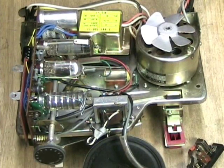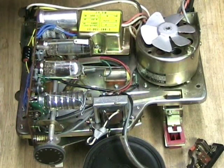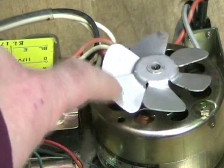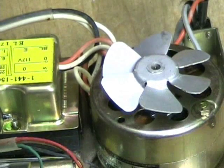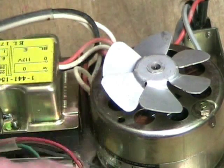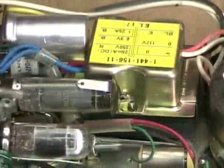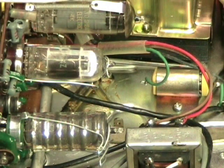Here is the speaker. Here is the control board for the input/output jacks. And here's an important shield that helps prevent hum and radio frequency interference. Let's take a look at the motor — it's a very high-quality motor with what looks like a six-bladed fan. This was absolutely filthy when I got it and just needed cleaning. You can reach under with an injection oiler and put some oil into the bearing. Here you see the transformer, providing power to the tubes and the amplifier circuit. And here are our three tubes: a 6AV6, a 6AU6, and a 6MP17.